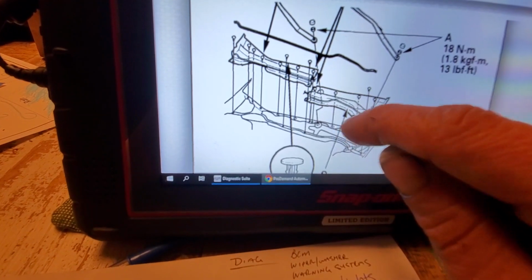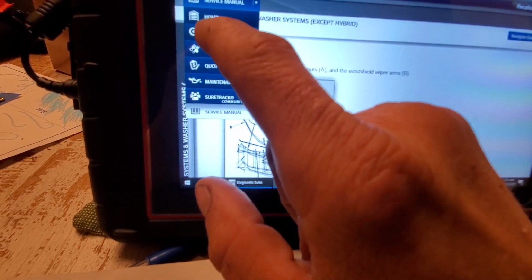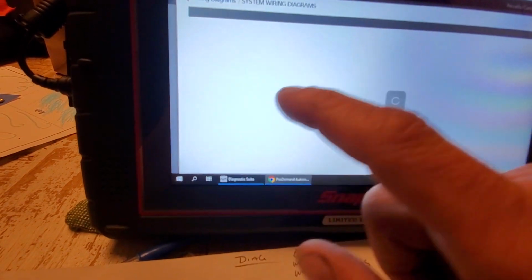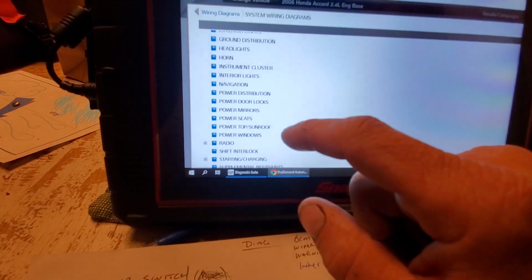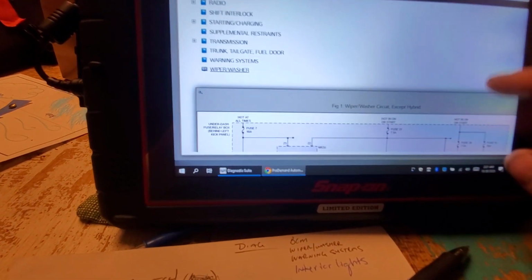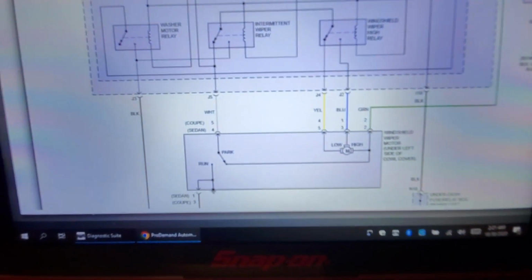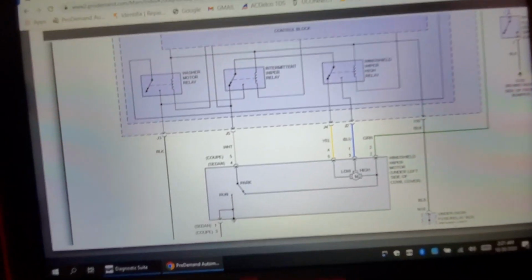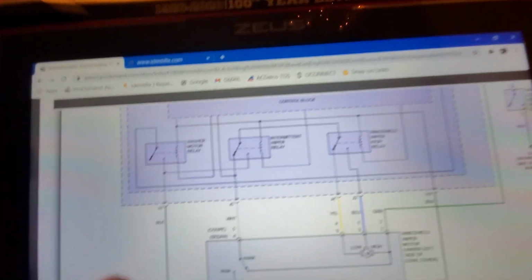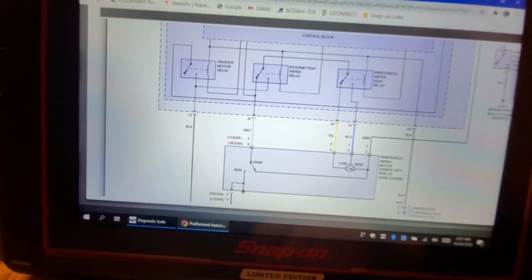I probably would go here because, and this comes down to personal preference, if we go back to our wiring diagram, all right, we already know everything that's going on. Again, we've sold that hour and a half. So the nice thing about going right to the motor is it's going to tell us a lot. It's going to tell us if we need to go on the input side of house, or if we in fact have a bad motor, okay?